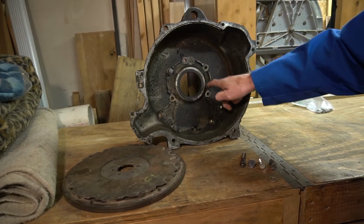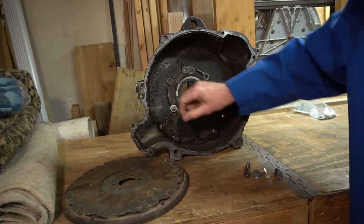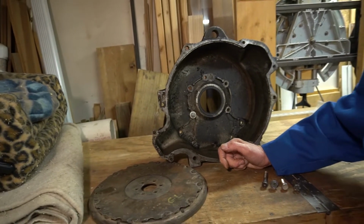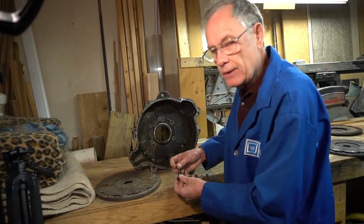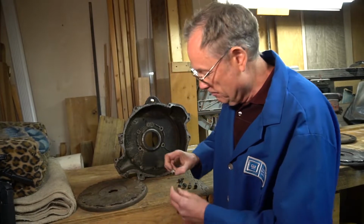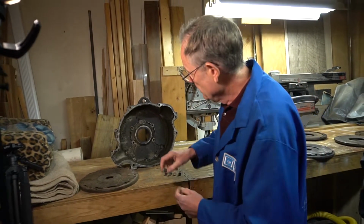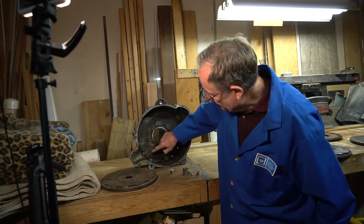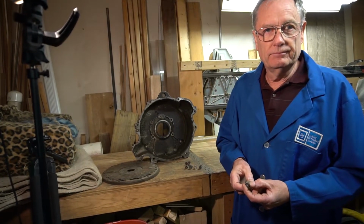The 5 around the top have a washer underneath them, and it goes together. So when you put it together, you say, well, look at that, somebody forgot to put the washers under the bottom too. I'm just going to go ahead and put washers under mine. Guess what? Now that bolt is sticking out the thickness of the washer more than it was before. And guess where the flywheel rivets end up when it's all mounted? Right in line with the inside edge of the bolt head.